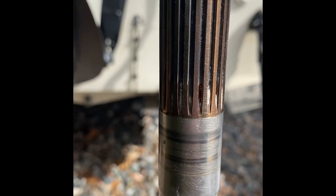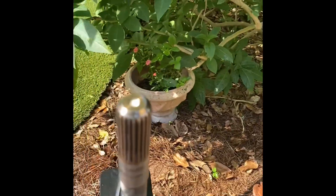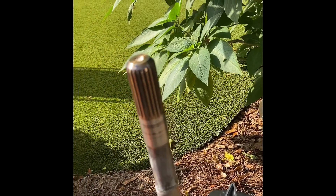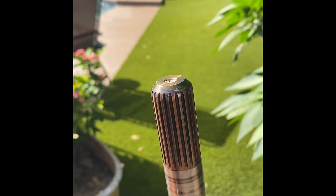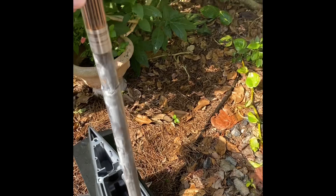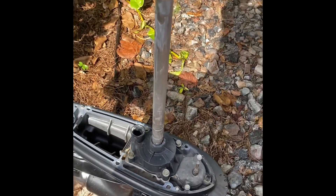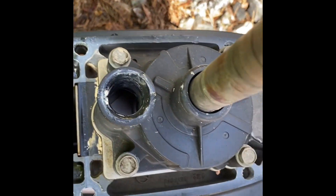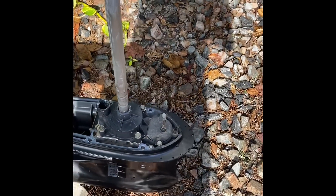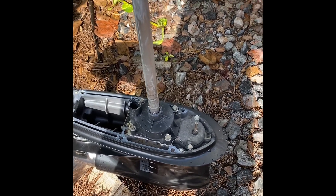I'm looking at the splines here — I don't see any disfigurement in them at all. I took a strike, hit a rock or something at about 40 miles an hour. I hit probably the bottom two inches of the skeg, which is probably the only thing that saved this engine and the entire tilt and trim system. All of this looks really good. Part of the maintenance I do is keep all of this well greased — I grease the entire drive shaft. This motor is seven years old and it looks basically brand new, and it runs only in salt water. If you want to have something you've got to maintain it, and being able to work on it yourself is important.